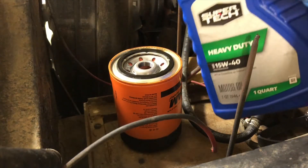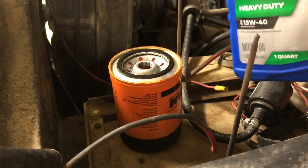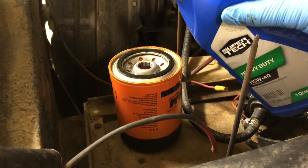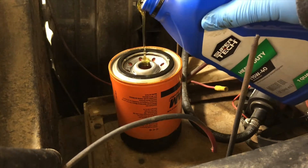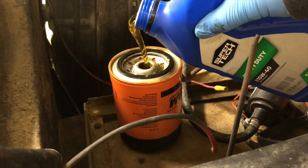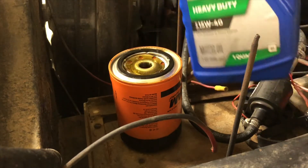I'm using an open quart of 15W40, which will not hurt this truck at all — in fact it's really good for it. It's a diesel grade oil that has a little more detergents and lubricants for the cams. I filled it about half full of oil — had to dump a little bit off. Now I'm just snugging it down. With that grip on top you can actually snug it pretty good — just a few soft turns. You don't want to kung fu it, meaning you don't want to strip the threads or the oil pan. Just snug it up so that it holds oil.